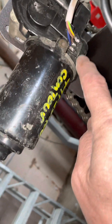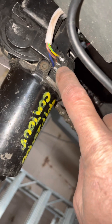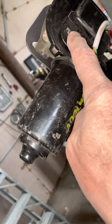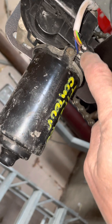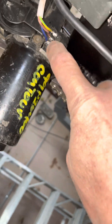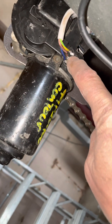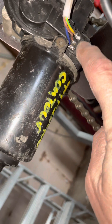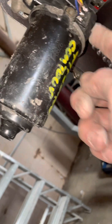I bypassed that plug. I ground down this little spot where the motor wires came into this shutoff for the park. I bypassed the park and I'm just using the blue and the yellow wires — not using the brown. I just ground that down to access those wires that go into a plug.